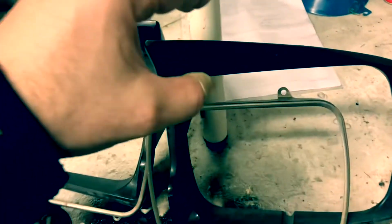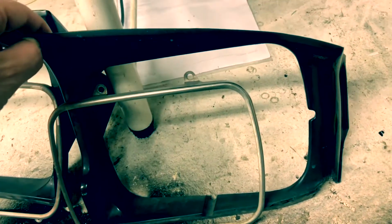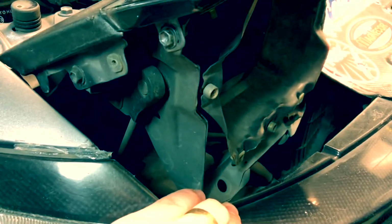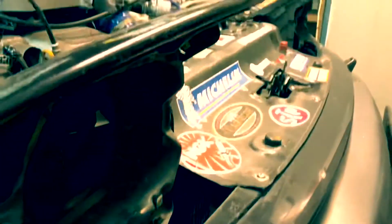The plastic cover that supports the entire frame here and makes the gravel and dust go away is possible to eject from the current position without removing any of the lips and spoilers. This one is in the way in the beginning, but as you push it downwards, you can by force eject the entire plastic cover. So not that hard, and if you want to save some time, you don't have to remove all the screws and everything. There's pretty much of them.